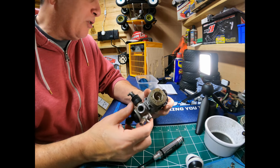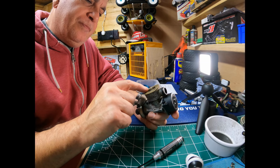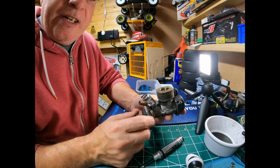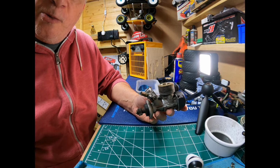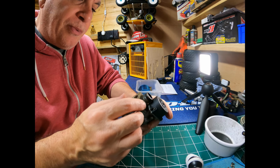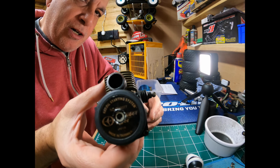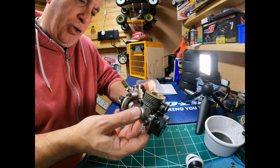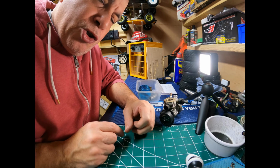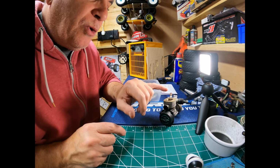Okay, so everything seems in good condition. So I think we'll leave it there. In the next video, we'll get the engine stripped the rest of the way, because I haven't got the bits for the car yet. So I don't know how long that's going to take. There's a couple of bits which are not in stock, obviously. But it doesn't say that on the website. We'll get this apart. We'll make an assumption. It has been run quite rich, because it's got a dark exhaust. So I'm not disputing the fact that it works. We'll see what we can do about that. Anyway, short-ish video into part 2, and then part 3 will follow in due course when we strip this down.